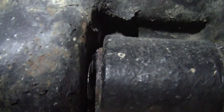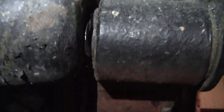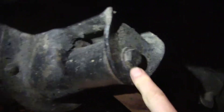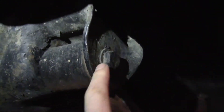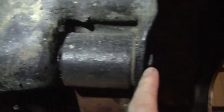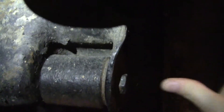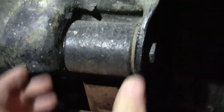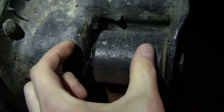I cut all the way through on this side, which is on the inside of the truck. Now I'm going to come over to the bolt head and grind this bolt head off because I can't get in between. There's a gap here, so I'll grind the bolt head off, take a punch and pound it this distance, and that should make the whole spring move over a little bit and fall.